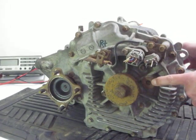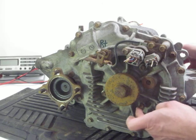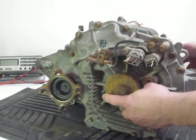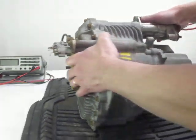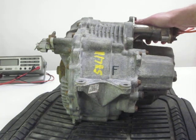Moving on, this plug you do not ever want to remove. You won't do any damage, but don't remove it — there's no need, and you should not put any oil in here. These three bolts hold the resolver in place, which is what this connects to, and you don't want to loosen these three small bolts on the right side. We've made it all the way back around to the front, and that is our Toyota Q211 motor generator. We'll be right back.